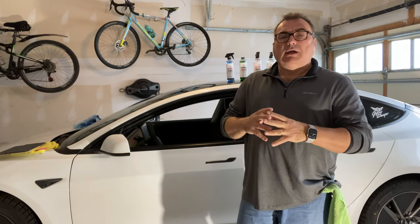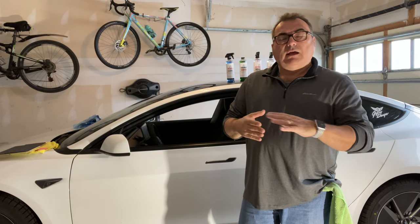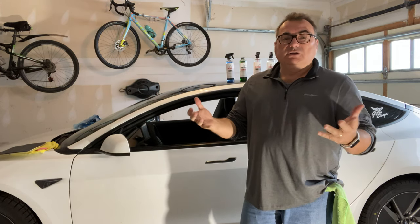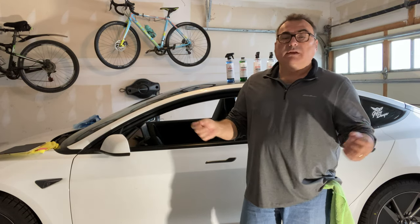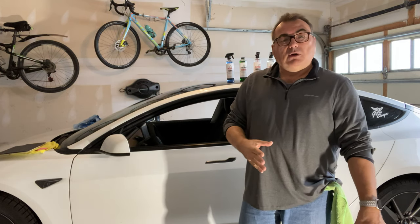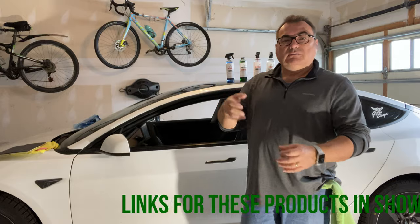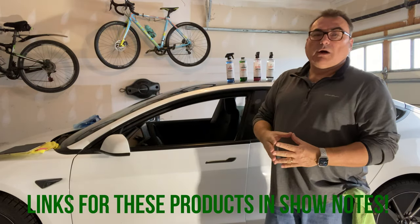That helps to bond the 3M vinyl onto the area once you're done, and to help tuck in corners and make the corners stick in a little bit better. You just gotta be careful. You don't wanna leave it on too long, because then you'll stretch and maybe melt some of the vinyl too much, make it too thin. So it's a nice art form going back and forth, keeping a steady movement. Take your time, use low heat. The heat guns are pretty warm, so for the ones that have adjustable settings, just use the lowest heat setting. That's more than enough, and vary your distance from the piece that you're working on, so you don't burn it or get it too hot.